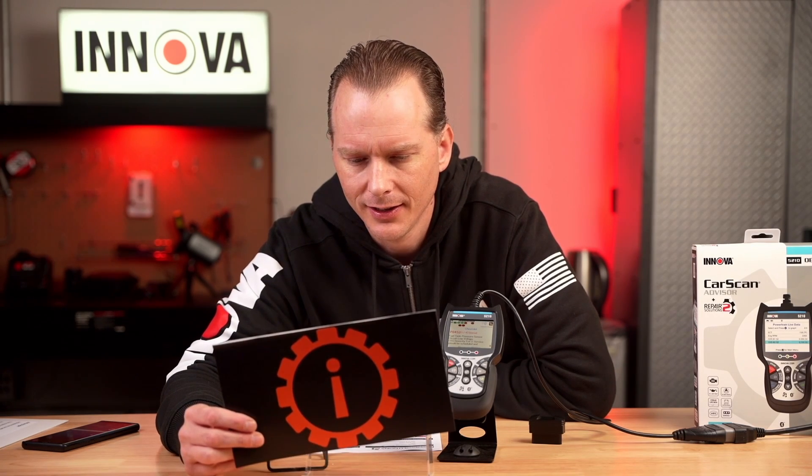And then you get these beautiful reports. Now let's go over the MIL lights. MIL stands for malfunction indicator lamp — the powertrain malfunction light. It usually looks like an engine shape, similar to a TPMS light. This is specifically the powertrain malfunction light, your check engine or service soon light. It will illuminate when the engine management system detects a fault — a confirmed trouble code that requires shutdown of an engine as well as immediate assistance by a professional technician. This is not common, and it's a very bad issue with your PCM. You do not want to drive when you've got that going on — get it home right away or tow it to your nearest mechanic.